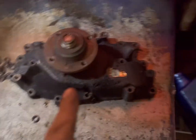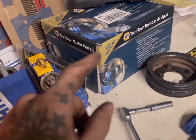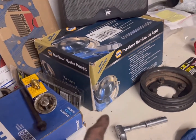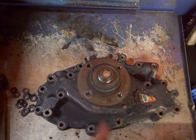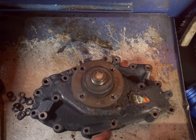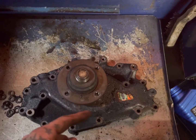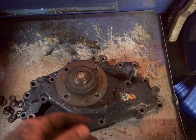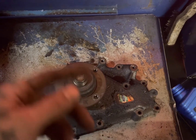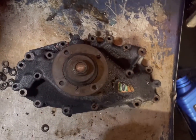Now let's move on to the water pump. Everything's been disassembled, cleaned up, and ready to go. I sourced a new water pump from NAPA — true new out of the box, straight from the factory. There are a couple of different ones you can buy; this is the one I picked up. Besides the normal housekeeping like cleaning the gasket surface and applying RTV, this follows one very important step: there are four holes that need to be RTV'd or thread-sealed because there's an interchange between oil flow and water flow — they need to be sealed.